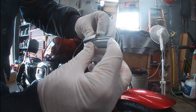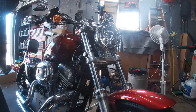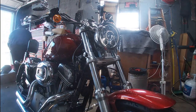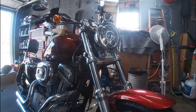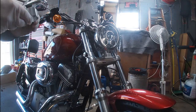Okay. This one looks like it could give me some trouble. Get it lined up here. I'm going to have to put a little bit of grease in that slide there so it'll go. There we go. Put a little bit of grease in that. Okay. Like I said, just a smear of lithium, just enough to make it so this aluminum slides against itself.